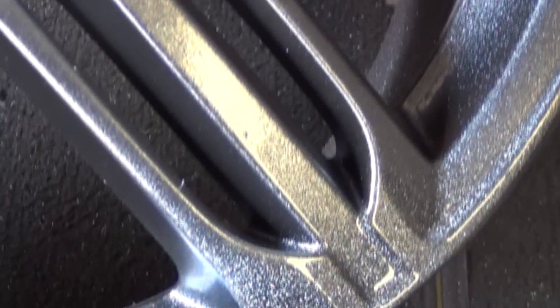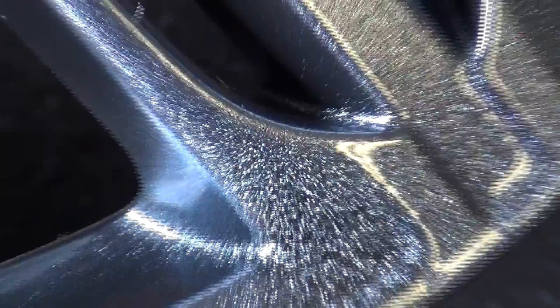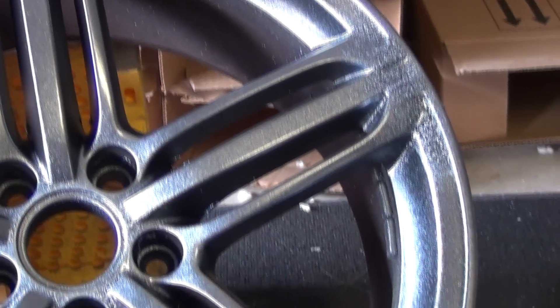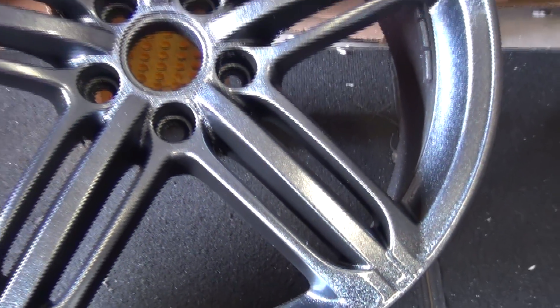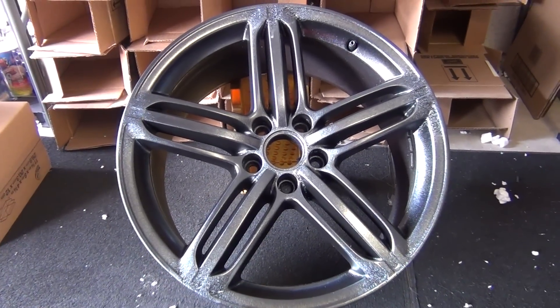This is the finish after four full coats of the silver metallizer over black. As you can see, it's really got a rich silver finish to it — almost like a gunmetal but with a lot of metal flake to it. I'm going to zoom in and you can see all that metal flake, and when you pull back a little bit, it just comes together with that silver finish. It really is one of our most popular products right now. You don't need glossifier on top of the metallizer because it has the glossifier built into the base of the product. You can also use the silver metallizer over our gunmetal exclusive color if you're looking for a brighter silver — something like a hyper silver — but this gives a metallic flake gunmetal type color.